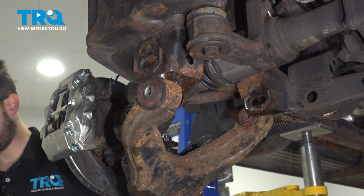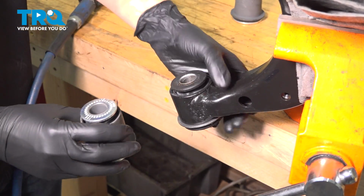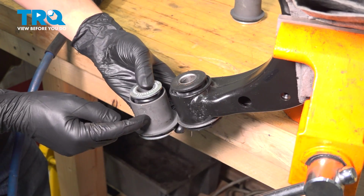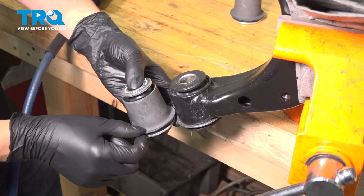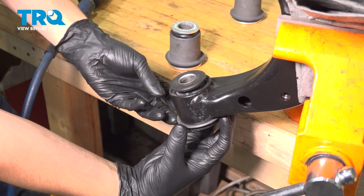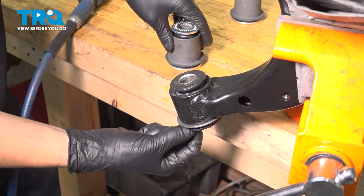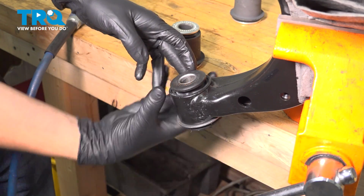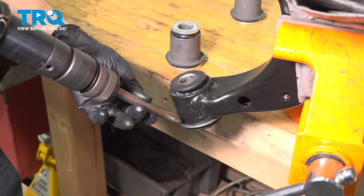There it is. I have my control arm clamped down in the vise. It's nice and tight. You're gonna need it because we're gonna air chisel this lip off, and I have this new bushing here so I can show you what's happening. It can only come out one way because of this metal lip here. So in order to press it out, we actually have to put a cup here so that the press can press down here and out here, but you have to support it. And the only way you can do that is, like I said, by moving this lip out of the way, peening it over so we can get the cup to sit on the control arm, not on anything else. I mean, there isn't anything else here. So take an air chisel and you want to bend this down and out of the way.